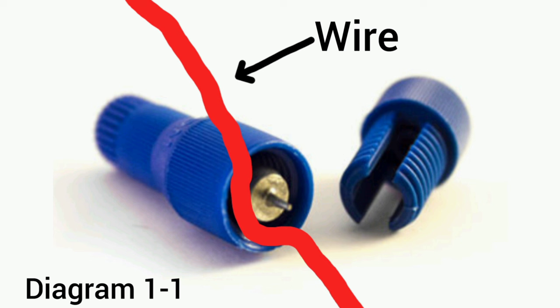Now let's talk about troubleshooting. 99.9% of problems come from wiring issues. I've had multiple people tell me their wiring is perfect, going over it again and again, and then three weeks later they realize a tap wasn't working right or something wasn't on the right plug. In my case, I had actually tapped the right wire, but looking at the taps there's basically a little needle in there that pierces the insulation and touches off on the wire to get the signal. My needle went next to the wire instead of actually piercing the insulation, so the wire was just sitting next to it — and that's why I wasn't getting the cam heartbeat I was supposed to.